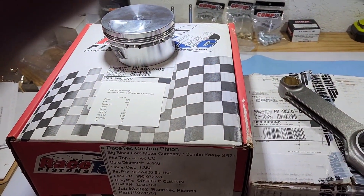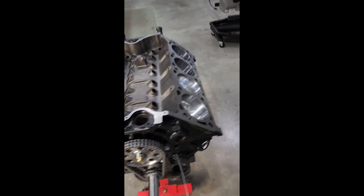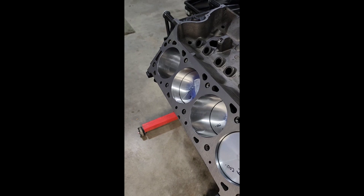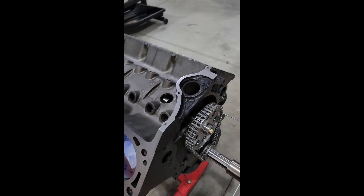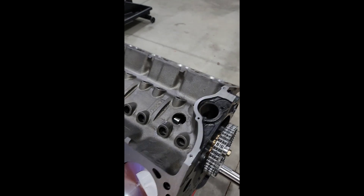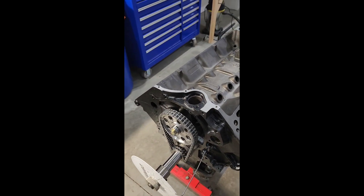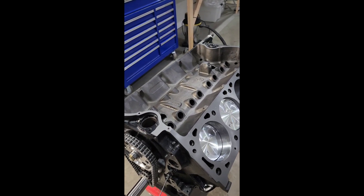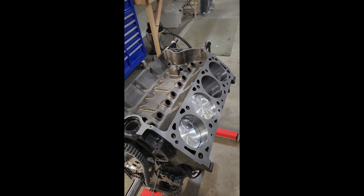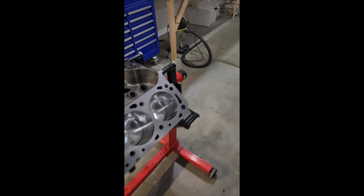The short block is together. The pistons ended up two thousandths in the hole, so I'm super happy with that. The cam is installed straight up. There's a bronze or brass cam retainer plate back there — got that from Kazi. The camshaft is a Comp Cams unit: 791 intake lift, 787 exhaust lift. I believe it was 273 duration at 50 thousandths lift on the intake, 280 on the exhaust, 109 degree lobe separation angle.